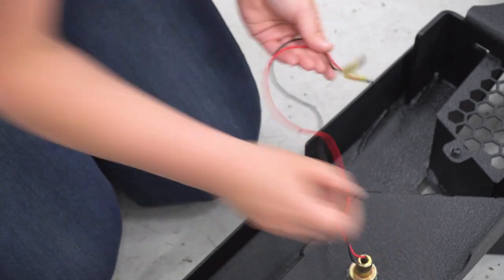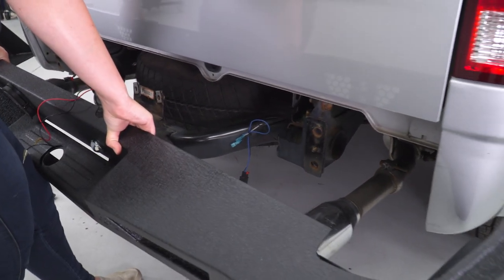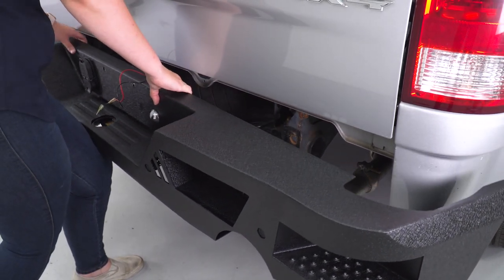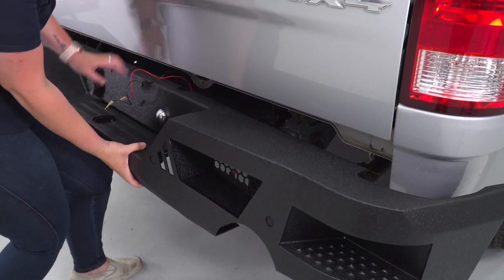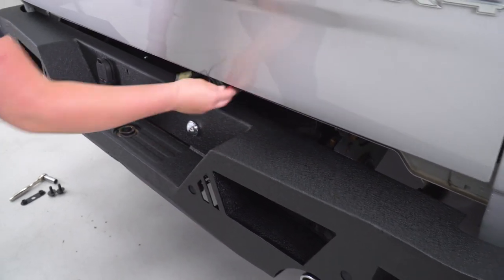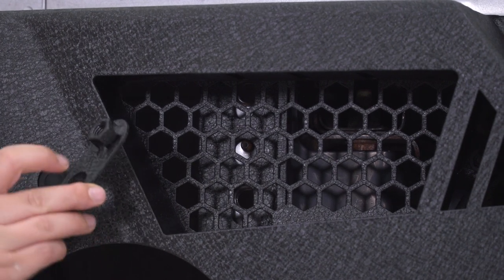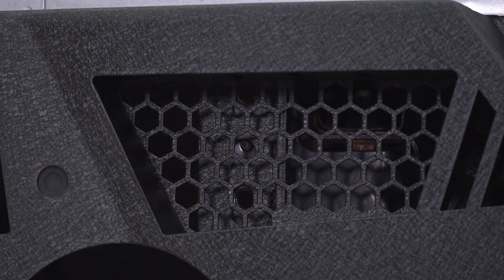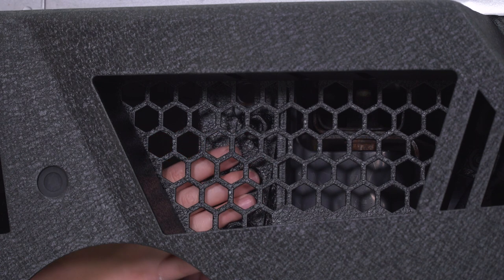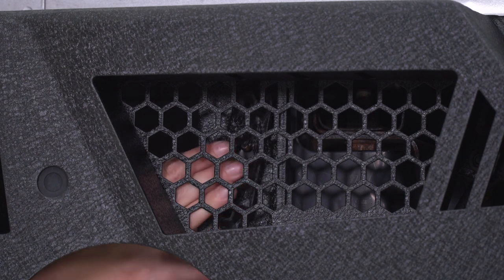After our bumper is prepped, what we can do is mount it up. Make sure that the center sits over this notch here. And once it's down and in place, what we can do is head over to the sides and secure it in the factory location. We can take our provided nut plate — there's gonna be a hole in the middle — and this notch that you can probably see through the panel is where we are going to place it over. Then we're gonna take our provided hardware, put that through our factory hole, and thread that into the provided nut plate.